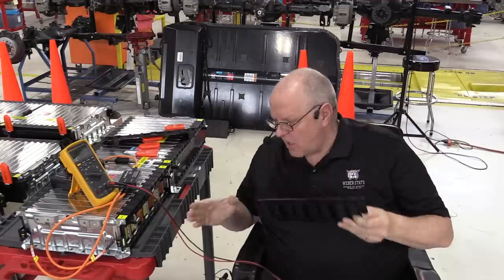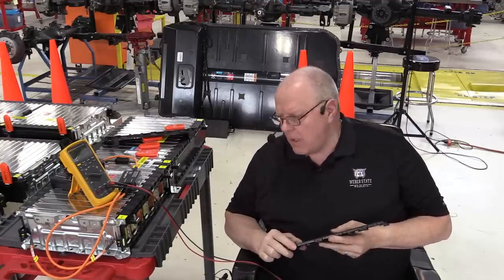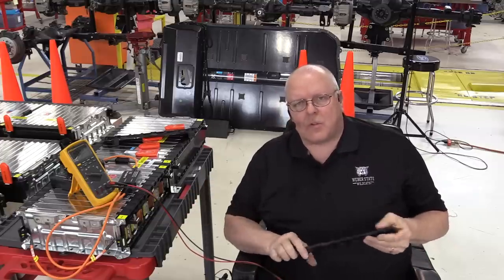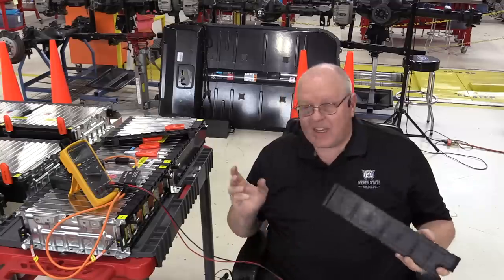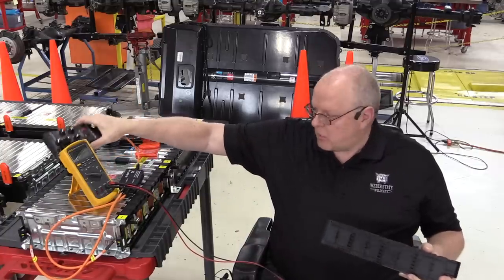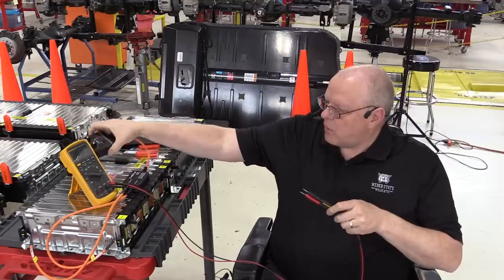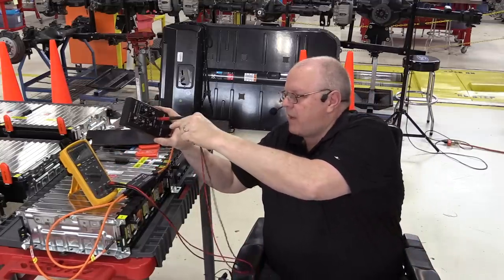All right, now taking these side covers off of the batteries is not an approved service procedure. There's possible damage, short circuits, and so on that could occur by taking that off. And so to make it easier, since there's already this electrical connection right here, we have this special tool that I told you about. So now, if I take the special tool and the multimeter and I plug in the positive and negative terminals,